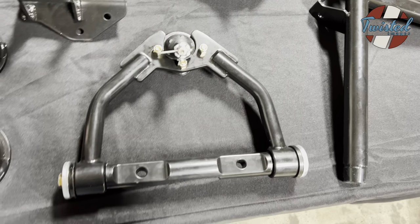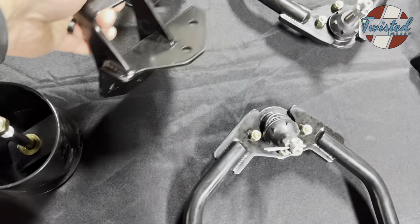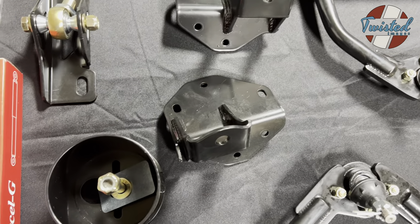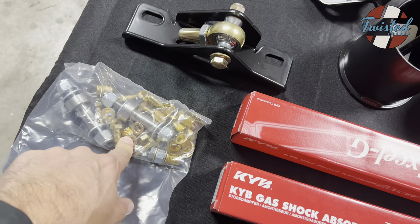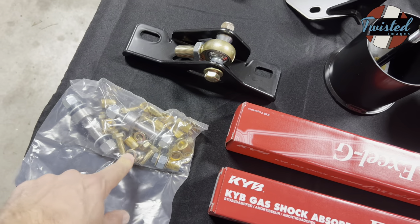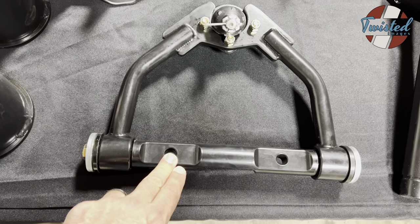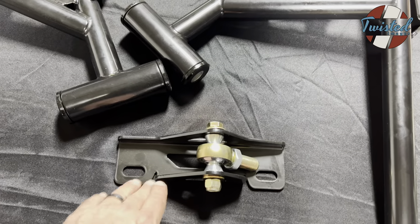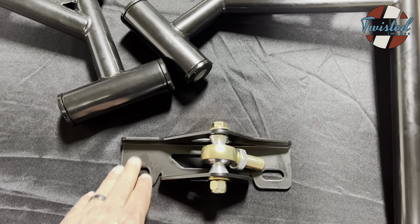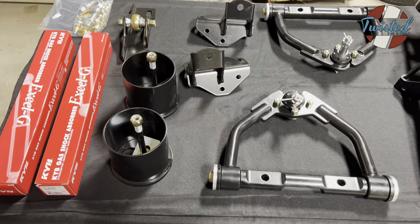If you wear the ball joints out, just go in and trade them out. The Chop and Block kit also comes with new upper bag cups, bolt-on upper shock brackets, a new pair of KYB shocks, and all the hardware — lower shock studs, nutserts, and mounting hardware for the upper shock mounts. As far as hardware you'll be reusing: upper control arm bolts through the cross shaft, lower control arm bolts through the cross member, and the tension rod bracket bolts under the radiator support. Aside from those, everything else is new.